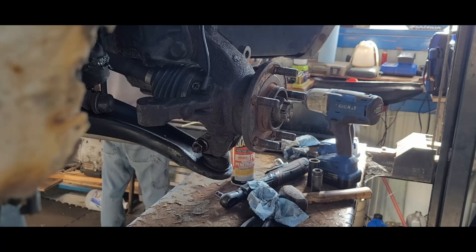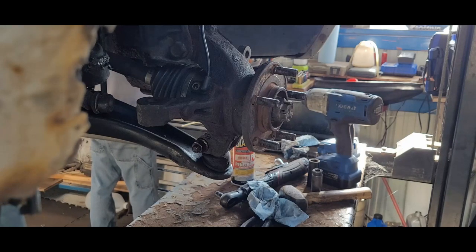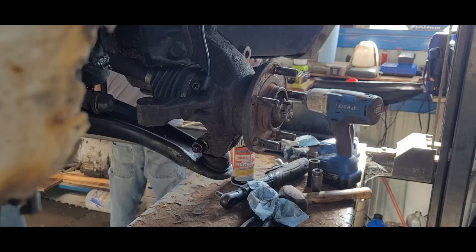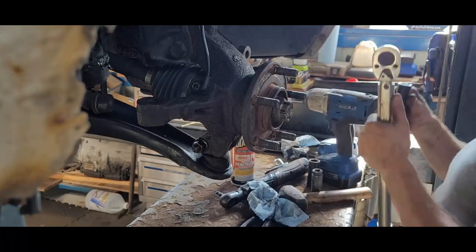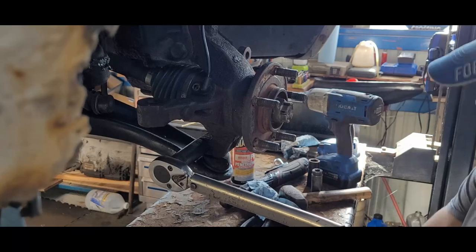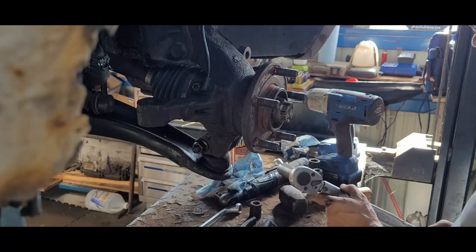Memorize anything, and that's my problem. Well, I can't memorize anything. I can't remember anything. Remember where I got it from. Alright, lower ball joint. Stabilizer strap, tie rod, ball joint pinch. 60 foot. Yeah, because I had the problem. The problem is I can't remember which one it was. I've had a ball joint drop out, and I know I had it torqued. Yeah, I'm already there.